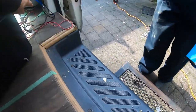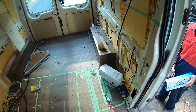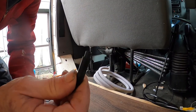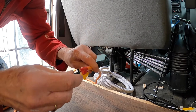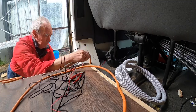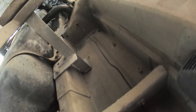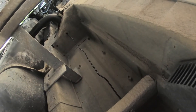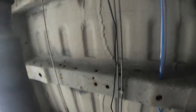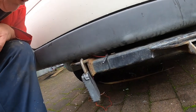Running it all the way along by the water tanks, all the way around, through to the back, and mount the camera somewhere on the rear bumper. To get the cable down through to the outside of the van, I taped it to a piece of cable I'd already threaded through, then pulled the other end so it would hopefully go all the way through. The cable comes out at the down pillar by the seatbelt, runs up through here, round the edge of the water tank, up round by the brake pipes, and goes on up to the back. I managed to pull the cable all the way through.